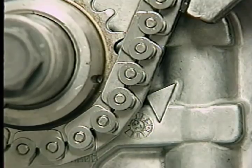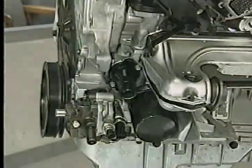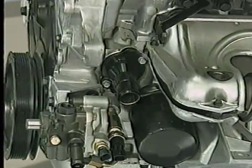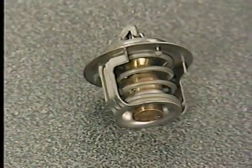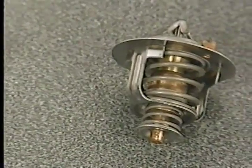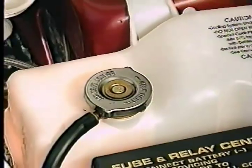It's important to keep in mind that none of these engines is freewheeling and that proper valve timing is critical to avoid valve to piston contact. The new engines have similar cooling system features which are different from the features on the previous engines. The thermostat on the 2.7 liter engine and that used on the 3.2 and 3.5 liter engines are located at the block's coolant inlet instead of the outlet as on previous engines. Because of this, both thermostats are designed to open at 180 degrees instead of the higher temperatures used with outlet side thermostats.